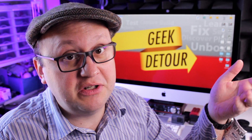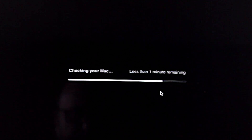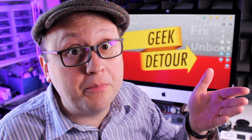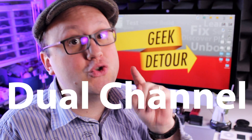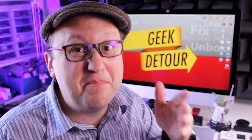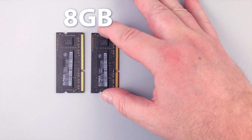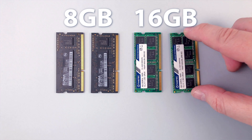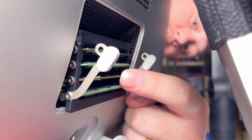Here is where I saw some confusion on forums and on YouTube. If you mix memory sticks of different sizes and put them in any order, there's a good chance your Mac will just work fine. I tested a few weird combinations, and the Apple hardware test on boot always gave me 'good.' And that is very disappointing — the Mac should warn you, because it's not all the same. Depending on the order, you get different results. So, can you mix different memory sizes? Yes, you can. But there is a correct arrangement to make the memory operate in dual-channel mode. I kept my original 8 GB in 2 sticks of 4, and I only bought an additional 16 GB — 2 sticks of 8. The correct order for best performance, from bottom to top, is: 8 GB, 4 GB, 8 GB, 4 GB.